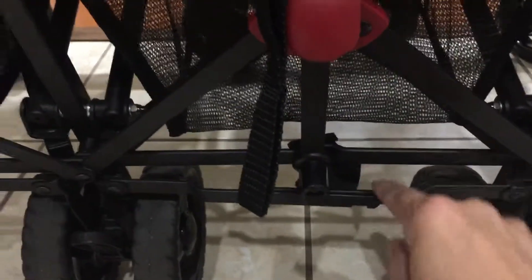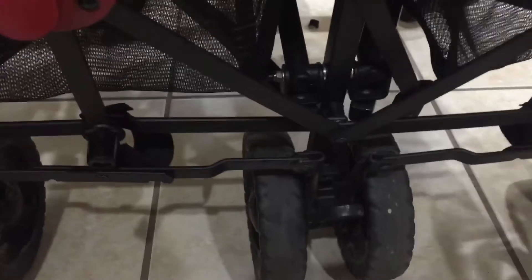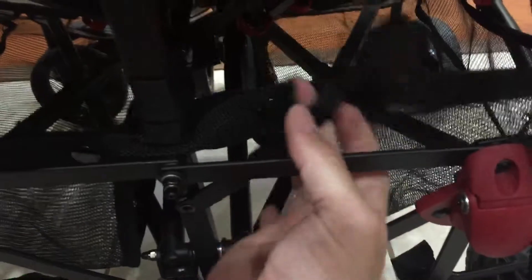The problem is that even with the brake fully disengaged, you can see this has lots of play in it. The brake is fully disengaged but it still moves — it doesn't stay under like it's supposed to. This part here doesn't really have any function that we can tell. We believe it is supposed to be connected to this piece, but as you can see, they're two totally separate pieces, broken apart in the middle.